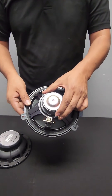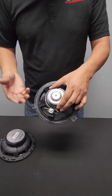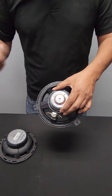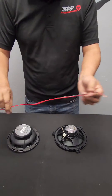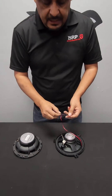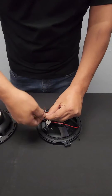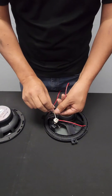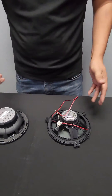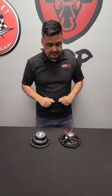It's always the factory ones that we're removing that cause confusion. As you can see, there's a white wire and a black wire. In some cases, the white will be positive and the black will be negative, but that's not always the case. I took a longer wire — one red and one black — just to make it easier. I'm going to connect it, assuming the black is negative and the white is positive, and wire it up. Then we're going to head over to the Jeep to figure out which one's correct.